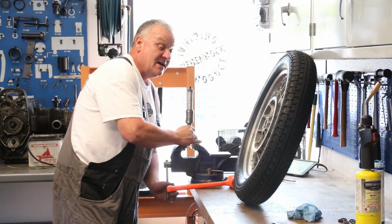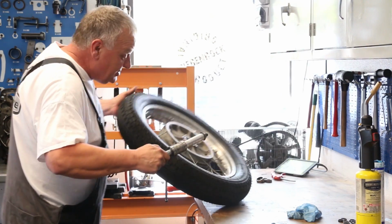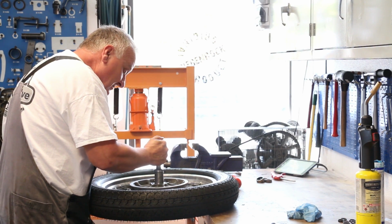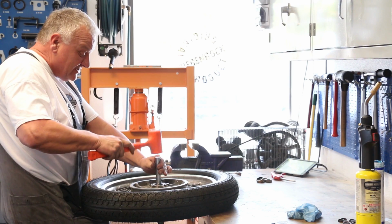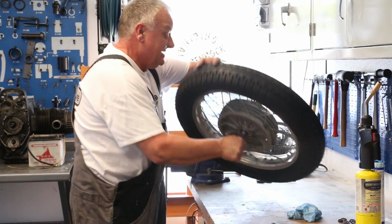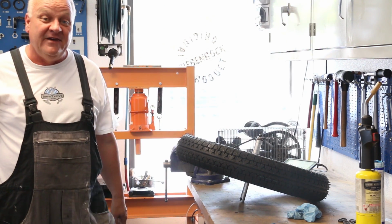Okay, that should be hot enough. So now moving quickly, I'm going to put the bearing pack right in here. See how that just went right in? Don't need to press or anything. Give it a couple taps, then I'm going to set it down on the axle like that, let it cool, and go on to the next phase.